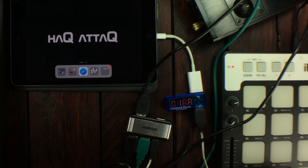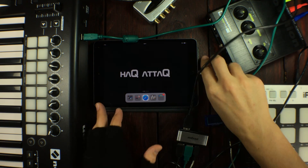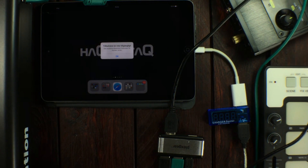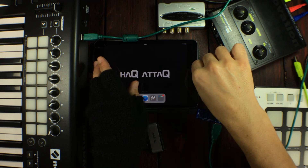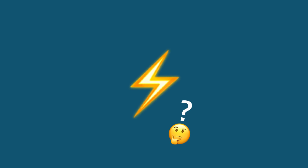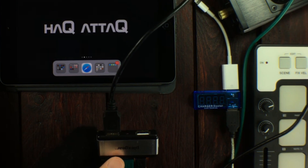If you're in this situation and you get a connection error from pulling too much power, you might think you can just unplug it and plug it back in. However, when I disconnect and reconnect it, it still won't start up the session — it's still going to give me an error. Why? Because of the Novation Launch Key MK2: when it starts up it goes through a startup cycle where the LEDs flash, which means it's pulling more power, and the whole session pulls so much power that iOS detects an overload and shuts off the connection. I think Apple put this into iOS to protect the battery from draining too fast or other power-related issues. In order to get this to work properly, we're going to have to power our USB hub.